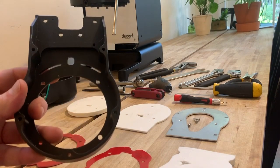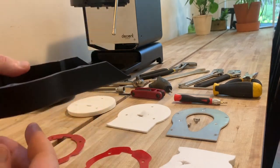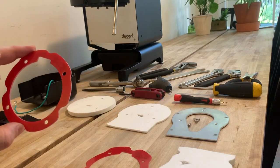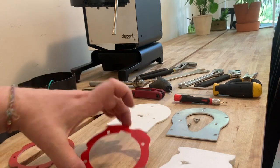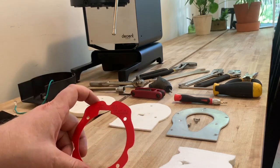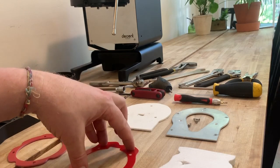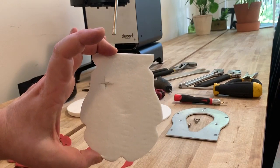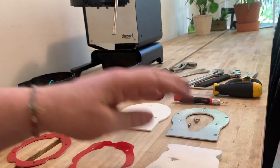Next we have the new through-drilled group support — you can see the holes are drilled through here — so we'll be replacing the old support with that one. Then we have version 1.1 specific PCB heat isolation spacers. The first one stacks into the group support and the second stacks on top. The order is important because there is a drain — in case there's ever a leak — and if you stack them the wrong way you may block the drain. This one always goes on top.